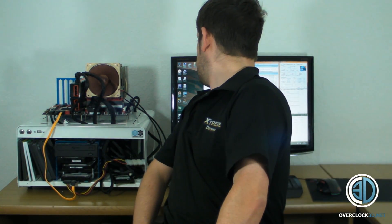It's actually running Prime95 at the moment behind me and I want to show you the temperatures. The air conditioner is off and it's got warm in here — I've been benching another rig beside me. It's 24 degrees in this room, and this processor benching at 4 gigahertz is sitting at 60 degrees across all cores. The hottest core has just gone to 61 and Prime's been running for about 45 to 50 minutes now.